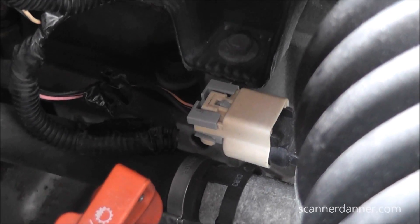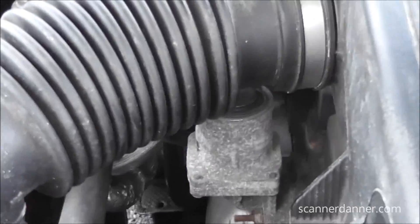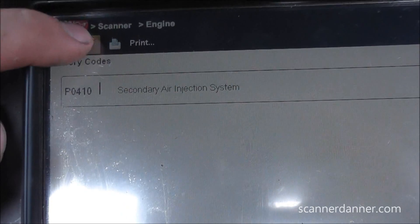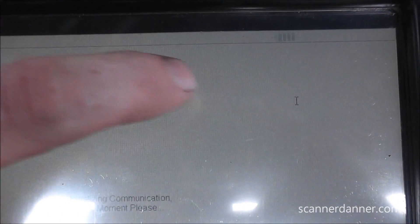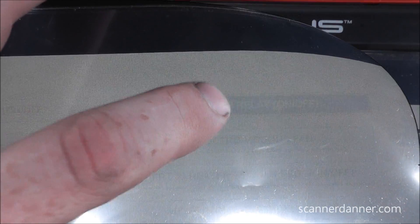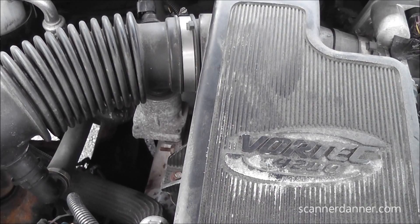I missed one step - I should have filmed this live instead of re-filming it so you could follow my thought process. I'm going to recreate what I did. Going back to the scan tool, to find this air pump I went to functional tests knowing it's electric, and I wanted to turn it on. Under output controls there's no air pump data other than the air pump relay. So I turned it on - you can hear the pump running - and that's when I eyeballed all the plumbing.